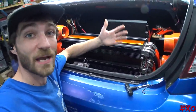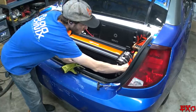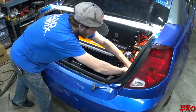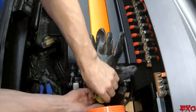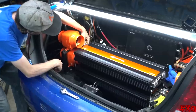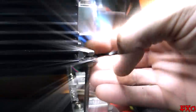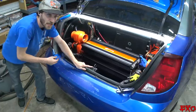This is where I go slightly unconventional — since the power and ground is still hot, I like to cover them up with some spare gloves. And just like that, the top row of positive and negative is all nice and safe. Now we can separate the two amplifiers from the threaded rod stack; we just got to undo those nuts on the top.